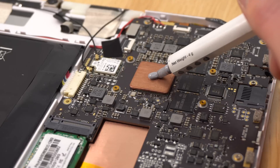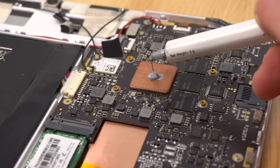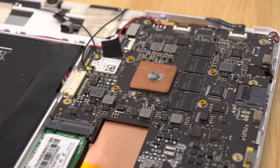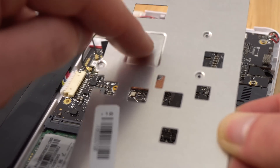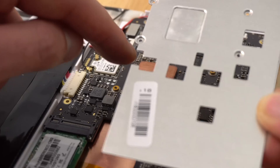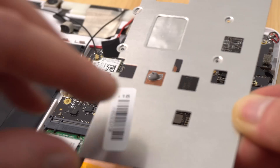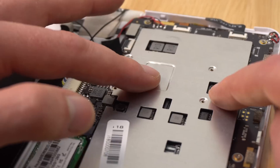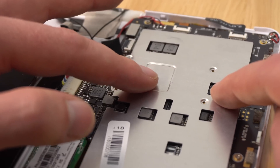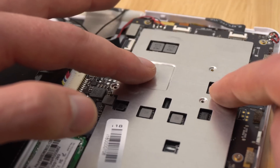I'm going to put a rather large dollop in the middle on top of the copper and try to make a better thermal paste job than I did on the chipset — about that size. Then we'll put the heatsink back on top. Now notice the surface of this is different — I used a hammer to try and level it out a little because we now have the increased width of the one millimeter thick copper shim. Give it a little wiggle to help spread the thermal paste on top, but not too much so we don't move the copper shim below.